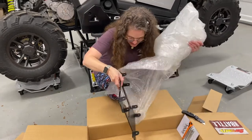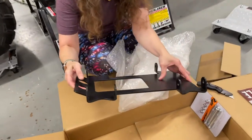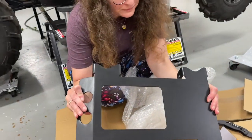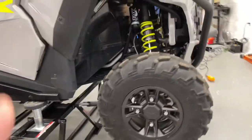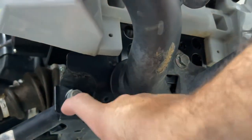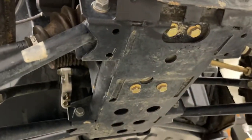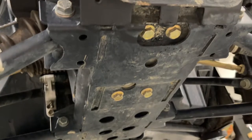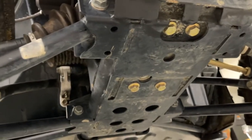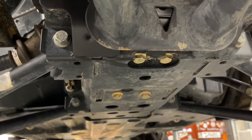Oh, this is nice — that is really heavy duty, heavy gauge steel, powder coated. That's a frame stiffener that will go in this area up front. Again, thank you for the recommendations. We've done a little bit of rock crawling and some of you have mentioned these tabs at the front can easily get broken off if you hit just right with a rock, and we don't want that. So we're putting a frame stiffener up front — it's really the only area that's not super protected. Everything else has a skid plate but that area does not, and we've already hit it a couple of times down the trail.